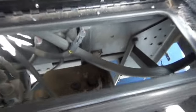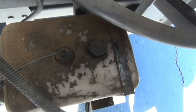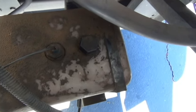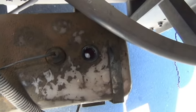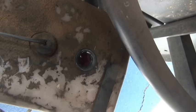So I figured out how to get under my step, and there is the reservoir right there. To remove that cap, you really need to wear plastic gloves — otherwise you're going to be picking grease off your fingers for days. So first, you want to start with your jacks up, and then fill the automatic transmission fluid into that hole right there as far as you can.